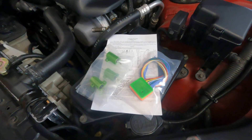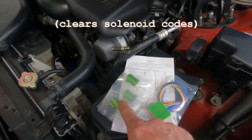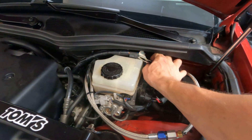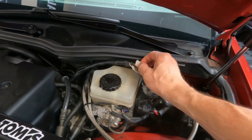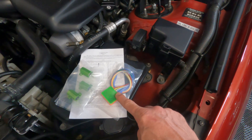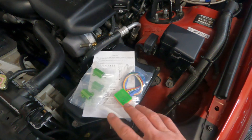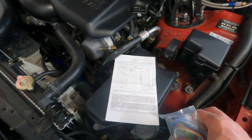This is what came in the box from Quantum Auto. This is your emulator right here. These are the optional resistors, which I am going to wire into those plugs as I showed in my previous episode. One plug has the connections that we're going to need to wire into these resistors. What happens is basically your VVTI system and your timing advance are completely whacked out, so that's what this thing does — it's going to hopefully restore a whole bunch of that.